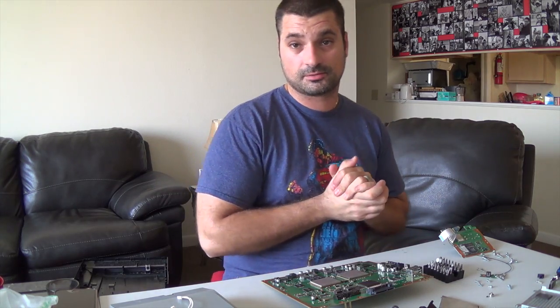Once the PS3 is done in the oven, we have to let it cool. That's going to take at least 15 minutes to let it get to where you could actually touch the chips and stuff. You don't want to be putting it hot inside the plastic — it'll melt. Plus, when you put the thermal paste on, who knows what will happen with that. Just take it out and let it sit. Since you have it on the tin foil balls, the air around it will cool it fairly quick. I always give it about 15 minutes and that should be good enough.